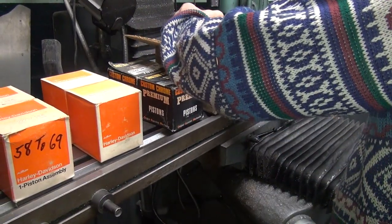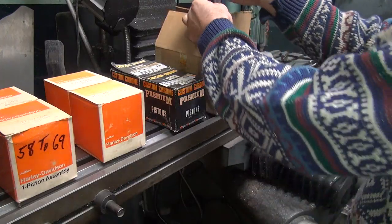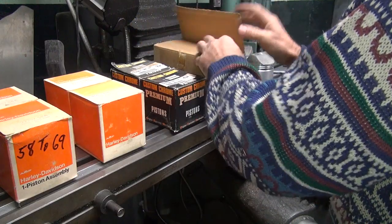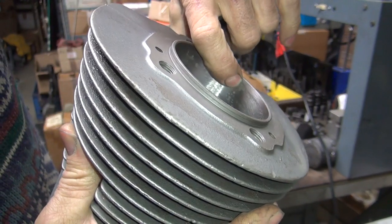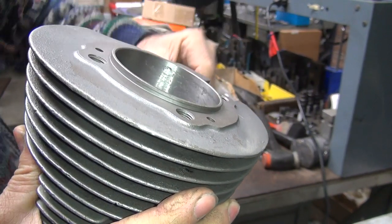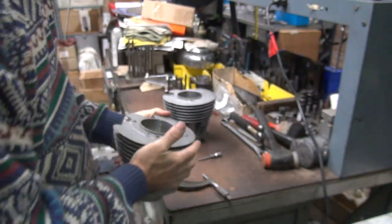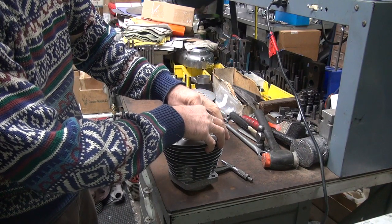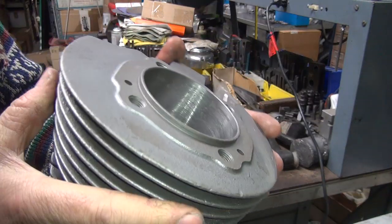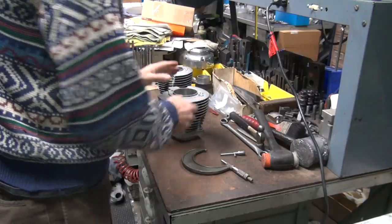The customer did want 100% clean cylinder, so. He didn't like my idea of leaving a little bit of pitting above the top ring land. So, the problem is you never know what these are going to be until you actually cut them. This is the worst cylinder. So I can bore it, see what happens, but I can't bore it all out because I have to leave honing. Yeah. So if I wanted to attempt to do this, I'd have to just start honing. Like I said, I don't think there's any way that's going to clean. So. Screw it, a little bigger.